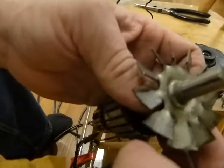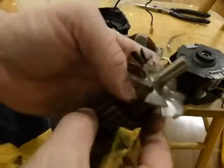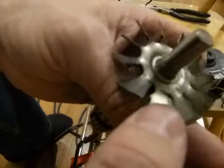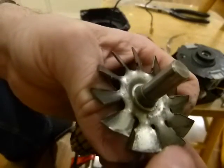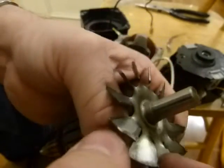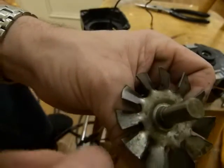On the fans, I just clean them with this rag — and that's all the carbon dust that came off from the brushes. It's in the milligrams range — very little. That's basically good to go. The edges are a little rough because that's how it's been stamped and bent when it was made. This whole star-wheel fan was stamped out with a cookie cutter and the fan blades were just bent with a simple twist — all mechanized.